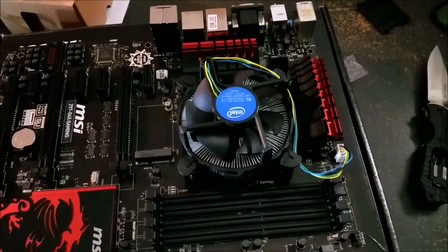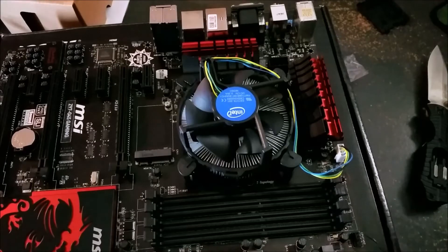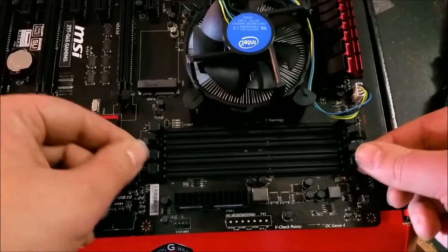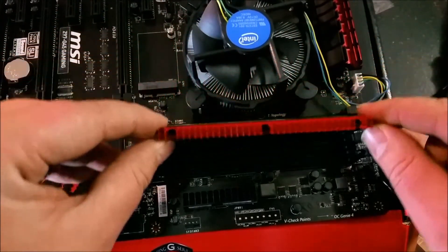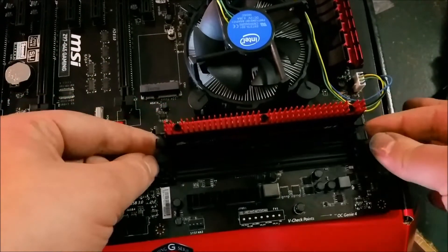I'm also going to install the RAM. I just did an unboxing of my Corsair Dominator GT — it's the airflow series because it comes with a mounting fan. On the motherboard here you can see it says to install DIMM slots 2 and 4 first. Basically on all RAM from PC-100 and up, line up the sides and press — you'll hear two clicks.